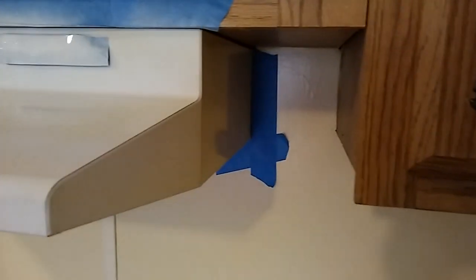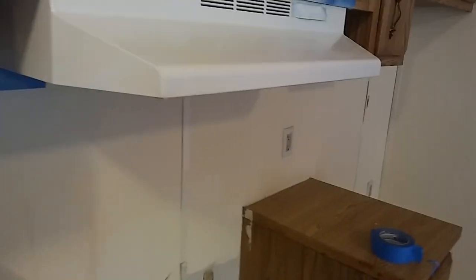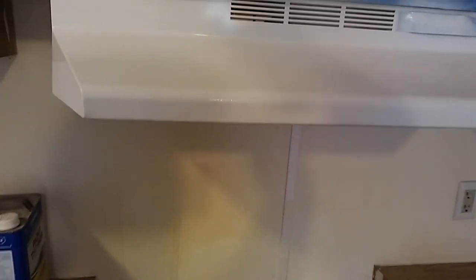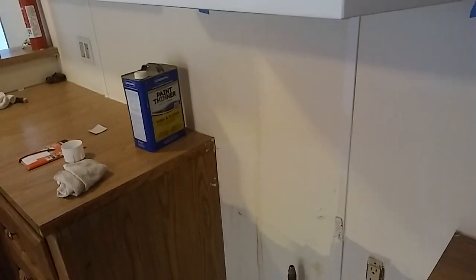I'm painting a stove top, but this could be done with the refrigerator, an actual stove, a sink — of course you'll need a different epoxy for the sink, but it's the same general idea. You want to sand it, tape where you don't want the paint to go, and use paint thinner to get all that excess paint off. Look at that — practically brand new. I'll go ahead and give it a second coat, light sprays, quick movements. You don't want to hold the spray can in the same spot for too long, otherwise you will get drips, and that's never pretty.